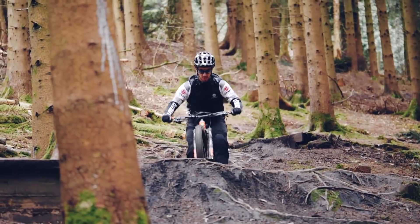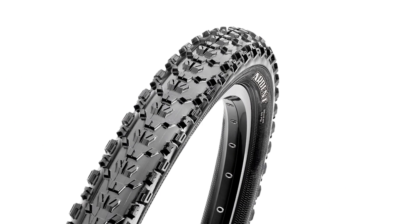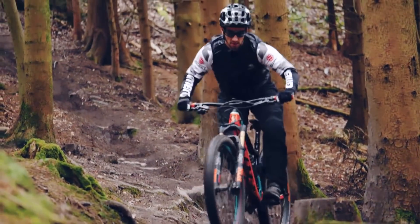Your body weight is over a faster-rolling, firmer rear tire so you go faster, while up front you've got the traction. Also take into account the tire tread — something like a High Roller is quite aggressive despite how fast it rolls, but you might not need that much traction. Have a look at something like the Maxxis Ardent — it's a really fast-rolling tire considering the size of the knobs, certainly much faster than the High Roller. Consider also tire size: a smaller tire feels faster but gives less cushion and traction. Weigh these factors up and find the best solution for you.